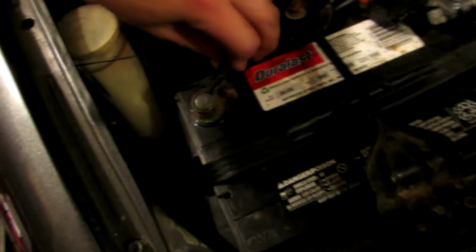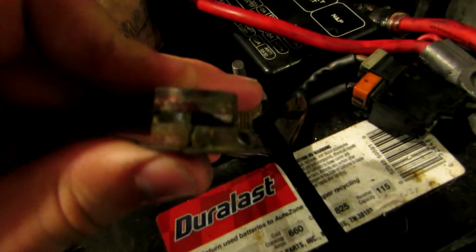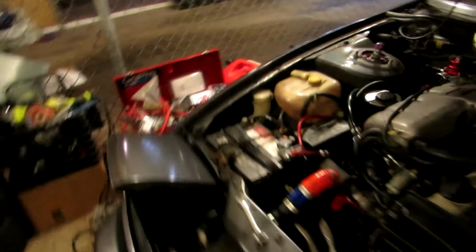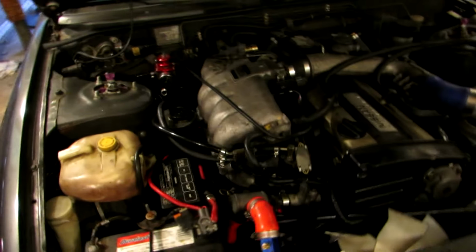Also online it says to check your ground here, see if you have a good battery connection. Right now mine is cracked, and maybe that has something to do with it. This is a brand new battery, and I know that I have battery power, because I turn on the car and all the accessories and lights work and everything has a lot of power. And the starter won't click or anything. And also, I inspected the harness under here just to make sure that the radiator hasn't burned through it or anything like that, because the tucked radiator is literally making contact with the harness. So yeah, that still looks like it's in good condition. And so I'm probably just gonna get a new ground cable before I go about replacing the starter. But we'll see how it goes.